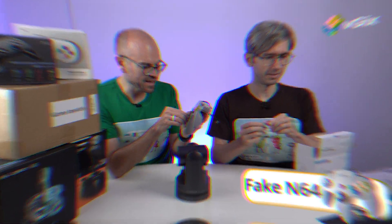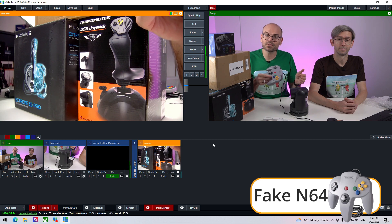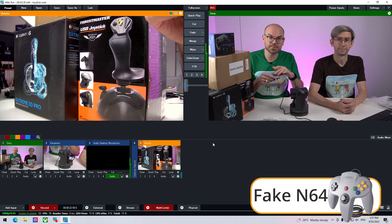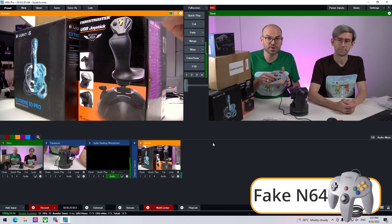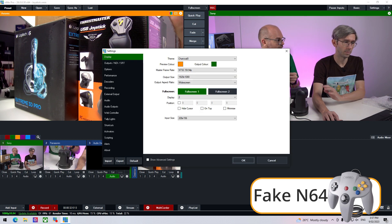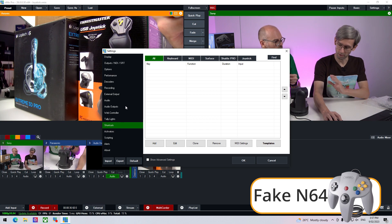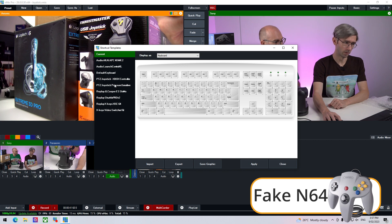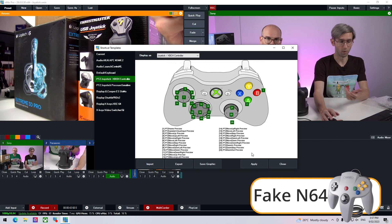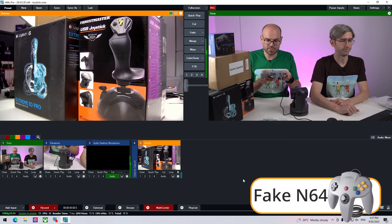We've got an extra one — a spare. So we've plugged this in and turned on vMix, and we've made sure to do it in that order because for joysticks to be recognized in vMix, you need to make sure that you've plugged it in and it's working in Windows before opening vMix. Now it's time to try and set up these buttons and joysticks. Let's go up to settings. We've already added our PTZ camera for our testing — connected it as Sony Visca over IP for this one. Let's have a look at the templates and assign the Xbox control and see what hits.